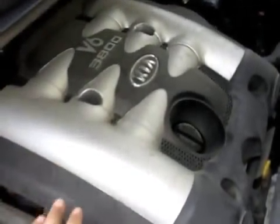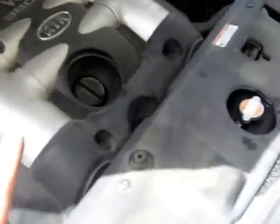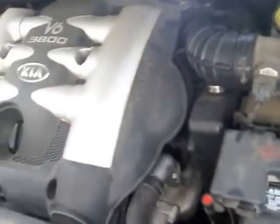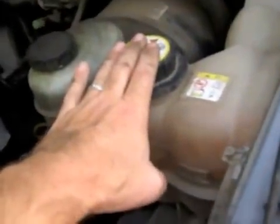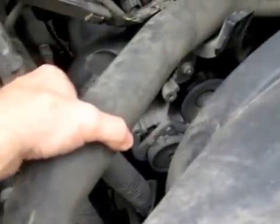If you run these smaller engines — especially Japanese or Korean-made vehicles — hot, it doesn't take much to really damage the engine. By the time the red warning light comes on the dash to tell you it's overheating, you've pretty much already done the damage. That light is almost an afterthought. Make sure whoever's doing your oil changes constantly checks the coolant level. Make sure there's nothing blocking the radiator — I've seen a plastic bag get stuck in there and diminish the airflow. Sometimes bugs get slammed in there and stop the airflow. Your oil change guys should be looking at that. Also ask about the heater and radiator hoses. This one $20 hose, if it decides to rupture while you're on the road, you need a wrecker — so replace them before they leak and before they break.